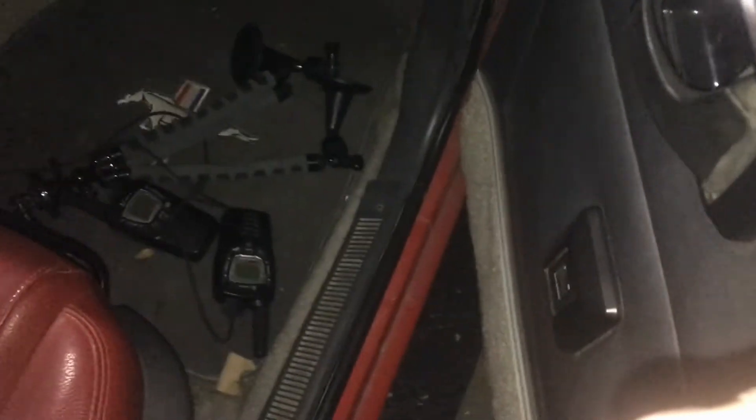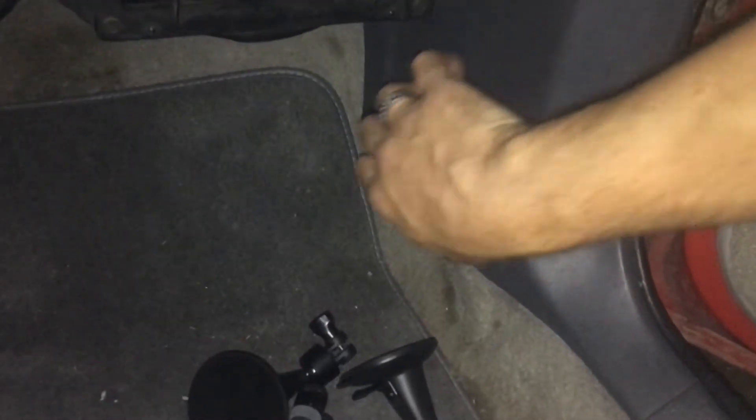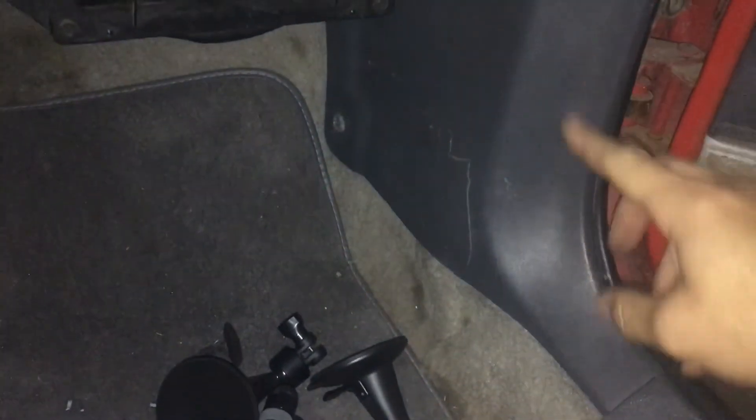For those of you rookies that do not know where your ECU is located and you do not know how to get it out, let's go through that a little bit. This is the passenger side kick panel here, and there's gonna be this trim piece that covers it up. Your ECU is housed back in here. There's this little piece that pops off here, and there's typically a couple of clips in here.